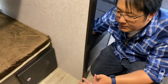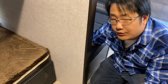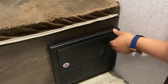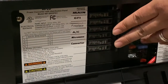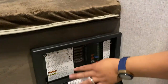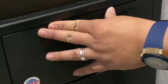Next, let's talk about the fuse box. If you accidentally pop the breaker by using too many appliances at once — say the microwave, AC, and heater together — it's just like your home electrical panel. The fuse box is right here; push it to open it. Inside you'll find all your breakers: GFI breaker, fireplace, AC, microwave, converter. If a breaker pops, all you have to do is flip it back on.